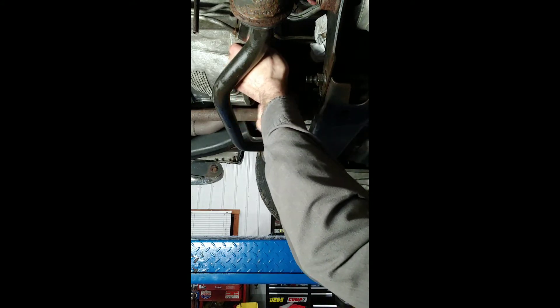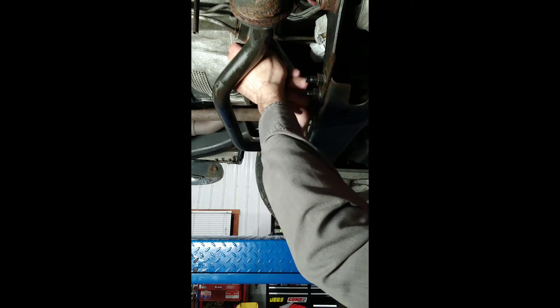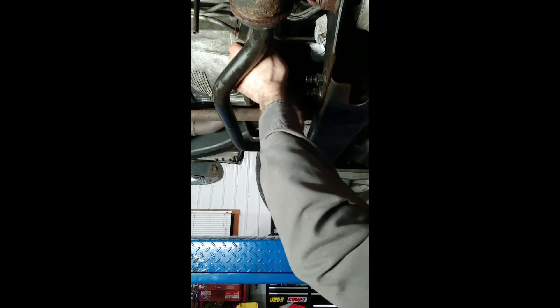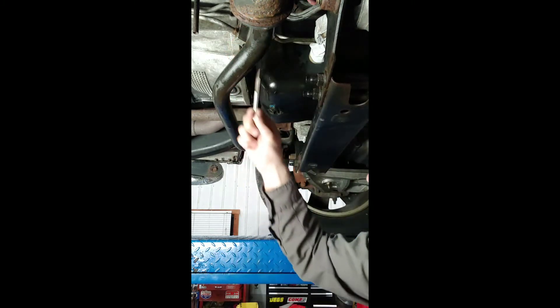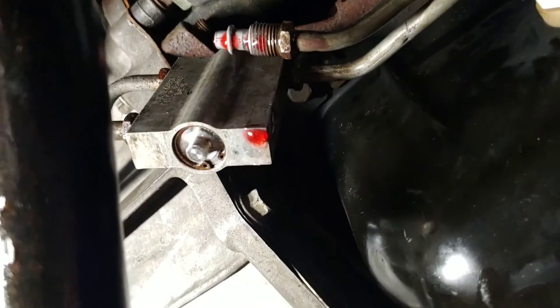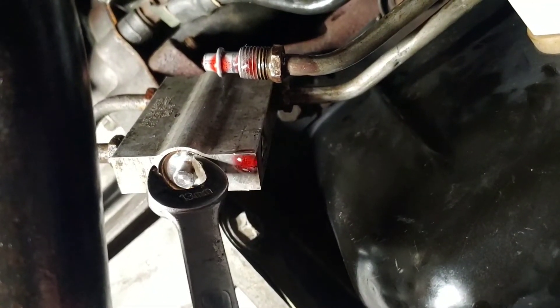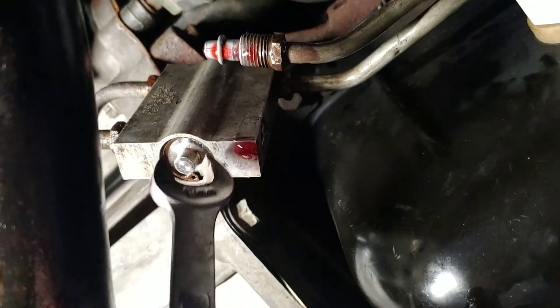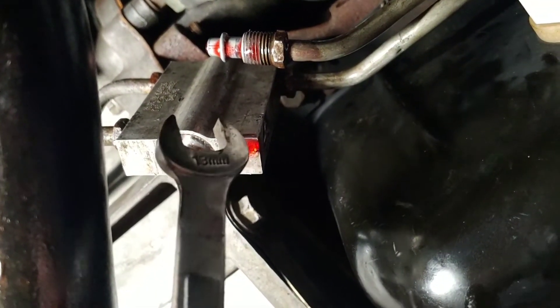Do not try to install the new little bypass valve — the insides of the valve — into the valve without removing it from the truck. This may seem like it's taking forever, but if you try to put that little spring and ball in there, you will not be able to compress it in there with your thumbs unless you are strong enough to get that snap ring in. Furthermore, every time you screw up and drop it, there it goes on the floor.